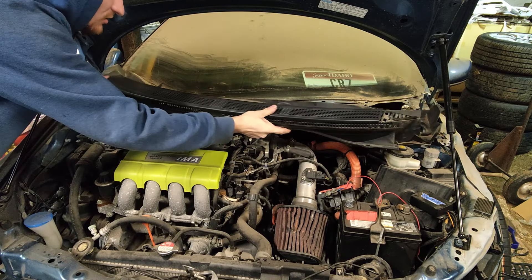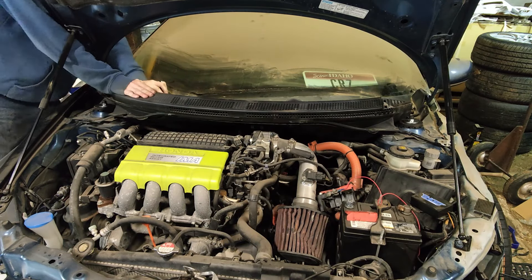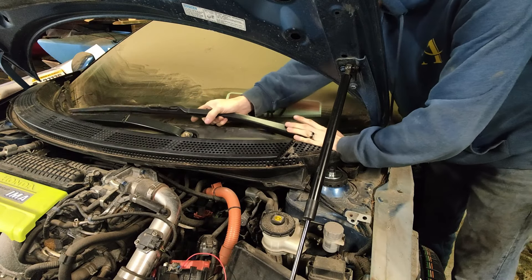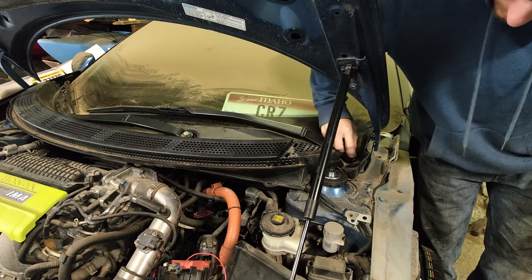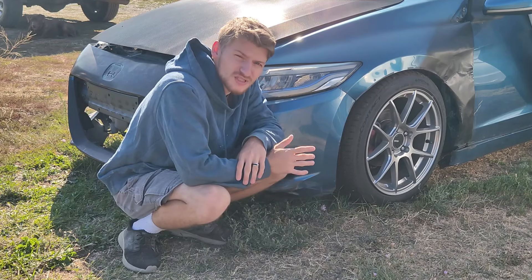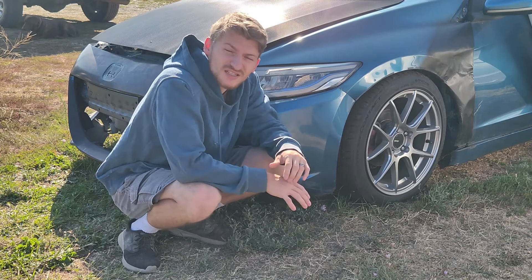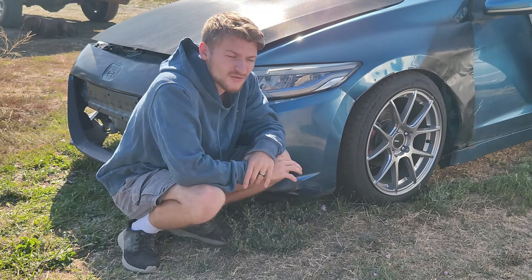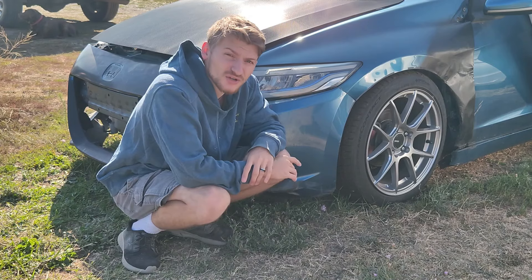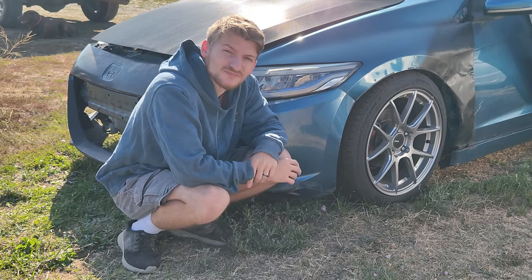Now that that's all done, we need to make sure and reinstall our cowl in here. That's about all there is to replacing the front struts and springs — the most important thing is making sure everything is tightened down to spec. We've taken it on a few test drives and it's handled much better. All the clunking on the front end is gone for the most part. We still need an alignment to really dial everything in, and we need to replace those control arms — so stay tuned for a future video. The suspension is much better and it's lowered down about as far as we want it. Thank you for watching.